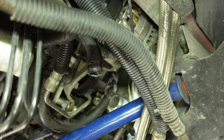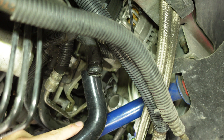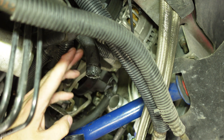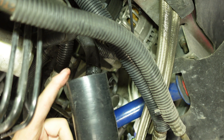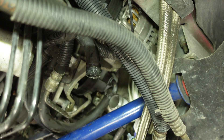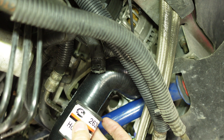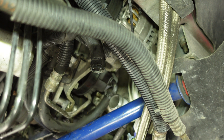If you're going to pick up the improved racing hose, this line goes all the way up to the degas tank and that goes up to one inch. The stock hose here goes from three-quarter to one inch up there. You're going to remove that and use this instead. You have to fish it up there. The straighter end, right closest to the T, is going to go to the lower radiator. Then the other end - if you want to run it to the stock cooler, you're going to have to fiddle around and use this reducer, because that reducer is going to fit perfect over that stock oil cooler. Cut that down - that's a good option. When I ship the hose, I send the reducer with you if you want to use it; otherwise, throw it in the drawer and keep it for another project.